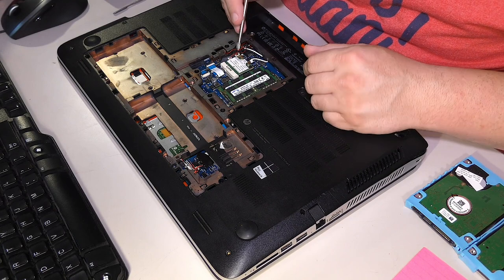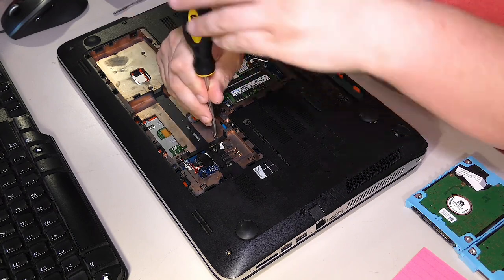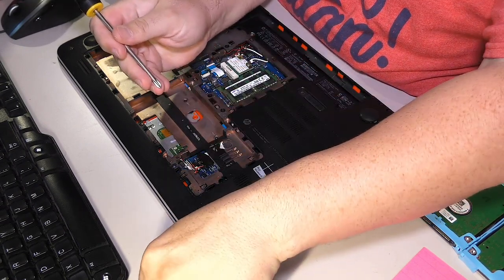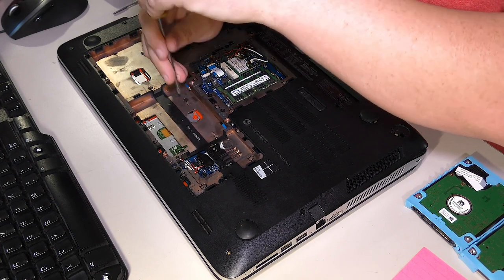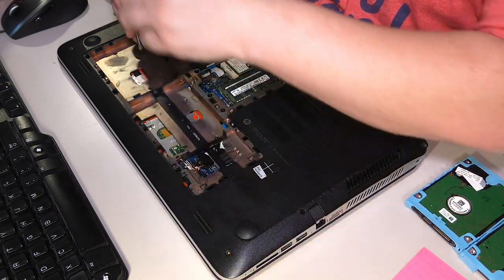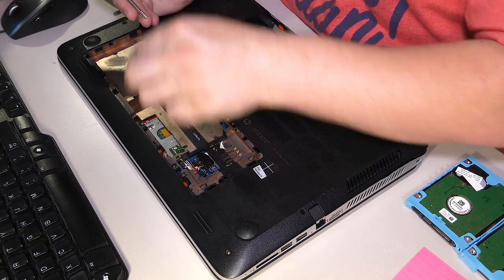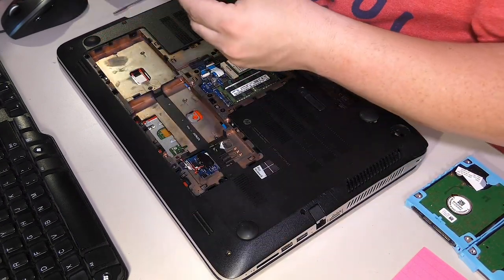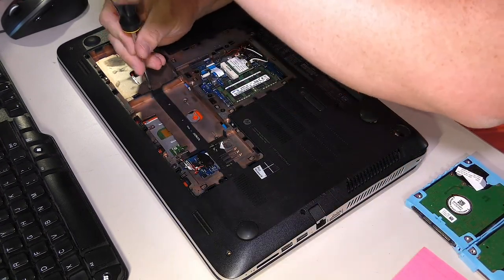All right. The Wi-Fi card's not part of the case there. We have more screws under the hard drives. Those appear to be the short type. Let's go ahead and pull these screws. Come on, get out. Oh man, there's a lot of them. There are five of them, it looks like. Five short screws underneath the hard drives, and that should free up this bottom case.